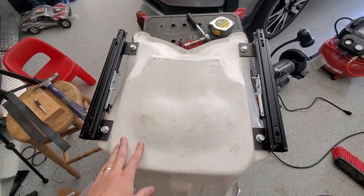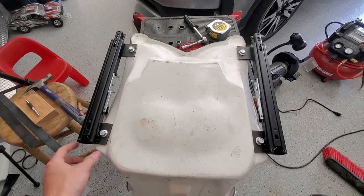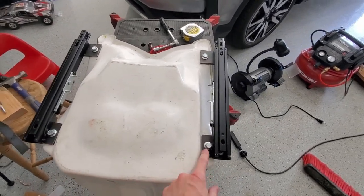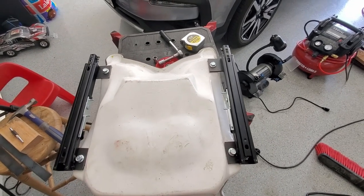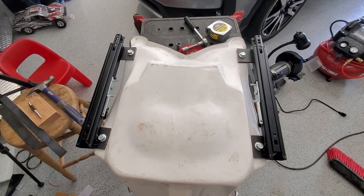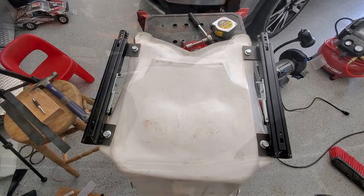The rails are all mounted — into the plates in the seat with a quarter-inch steel plate, and the rails mount to those. I measured pretty close several times from rail to rail, front and back, so I think they're parallel. I really hope they don't bind; I don't think they should. Now I'm going to weld some steel in the car to get this thing mounted. I welded some nuts onto here so I could bolt this to there, and I've got them on both sides. I think I'm ready to weld the piece to the frame.